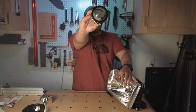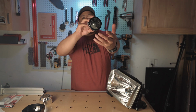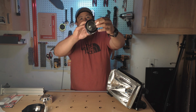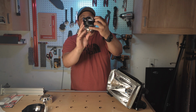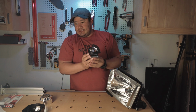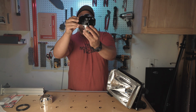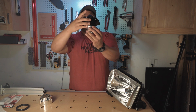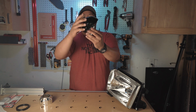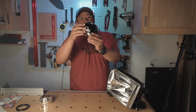So once you put it on the shroud, put the whole thing on here, and it should be a really snug fit. I just line it up perfectly with the edge of its own plastic, and that's how it sits. So what that shroud does is it prevents this thing from flopping everywhere. That centric ring holds this thing perfectly straight. If not, it's gonna move on you when you try to glue it. It's gonna pivot and move, and it's gonna come out crooked.